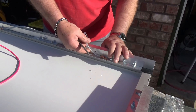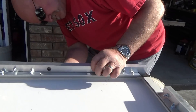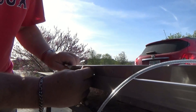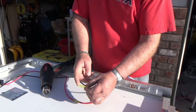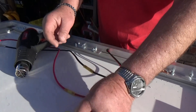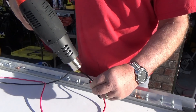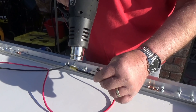Just taking the file to deburr where we drilled the hole, because this is plastic-coated wire and we don't want it to catch on any metal. The reason I use plastic is I don't want it to scar up the side of the trailer. Crimper, and then they're watertight sealed — you just use some heat and it seals up around it and there'll be a watertight connection.